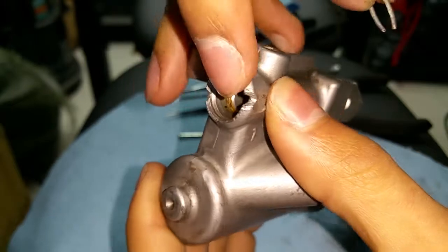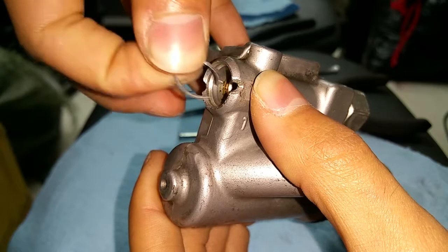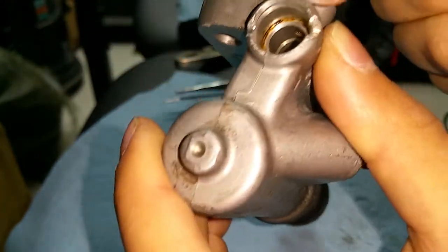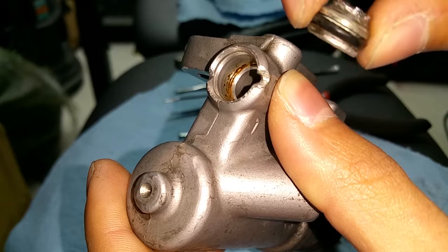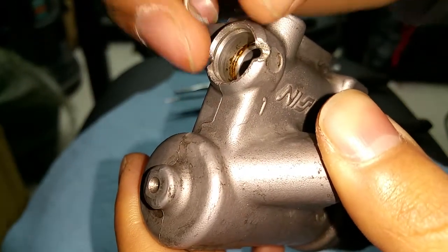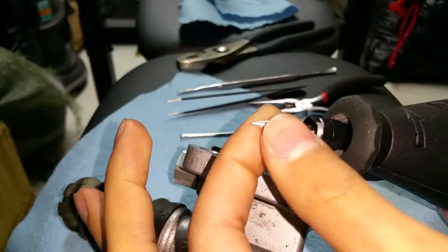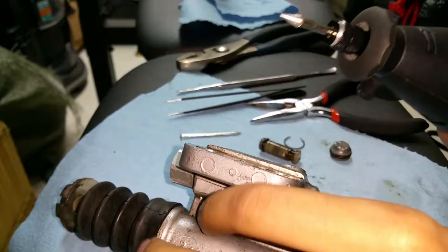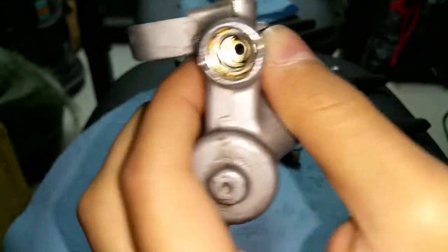You need to be careful — you can get to this pretty easily after you drill the notch into here, because it's going to be sitting flush with the piece I removed. Try not to go too far down the collar because you might damage the O-ring that comes in here. So what I did was knock in here and get this cotter pin out, which took me about two hours. I used a small Dremel — a metal bit is harder than the aluminum so it cuts through easily — and I was able to fit it in and drill it out until I came flush with the actual ring itself.